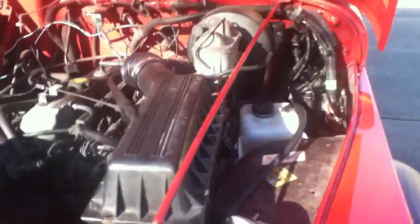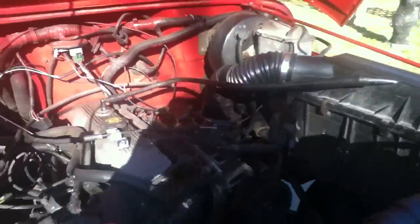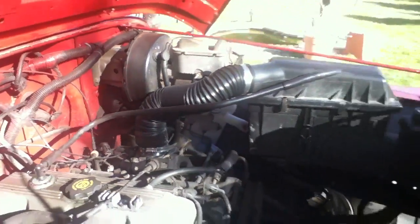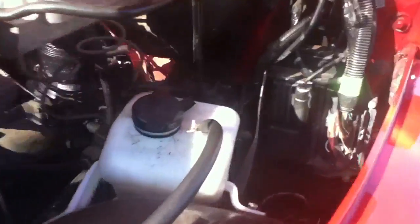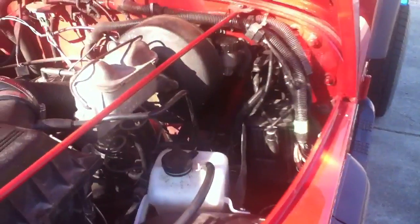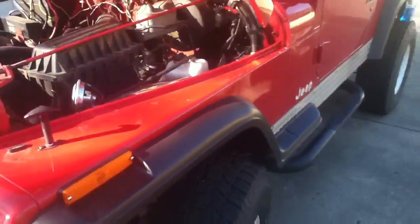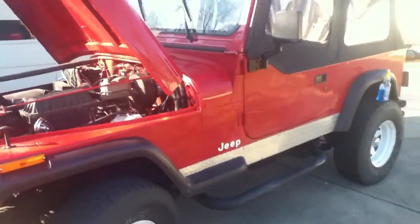After changing I don't know $120 worth of sensors and really getting aggravated by it, I'm glad I found it. I just thought I'd tell you, maybe it'd help some of you out there. I've never run into it before — that PCM mounting screws loosen up, let it vibrate, and back that connector screw out. But it caused a lot of problems. Just a short tip — hope it helps somebody. Talk at you later.